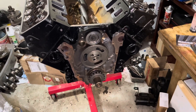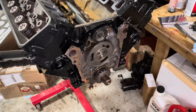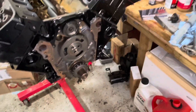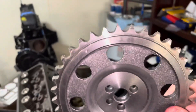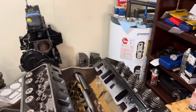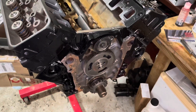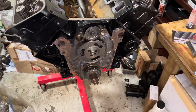Having said that, the marine versions of these engines use a heavy-duty timing set. This is the gear, and you can see how heavy-duty and big the sprocket teeth are. I think it's a 3/8-inch wide chain. That's what you want — all the marine engines I've taken apart use these large, heavy-duty chains and gears, and that's what I'll put back in my rebuilds.